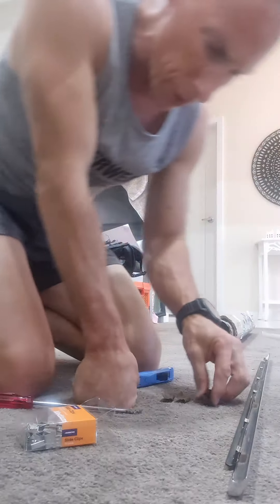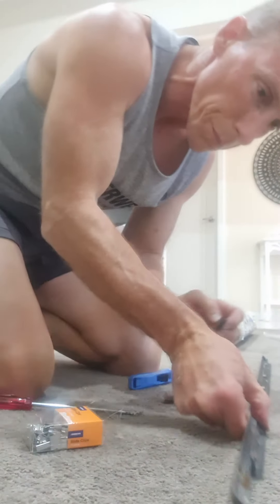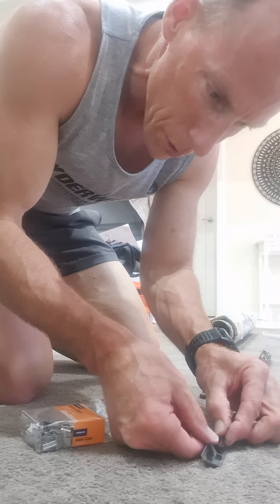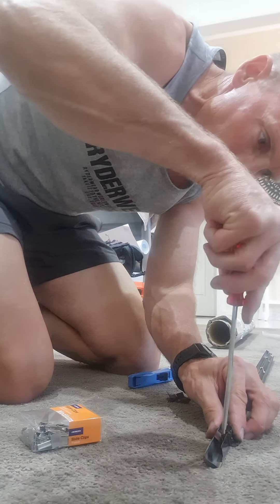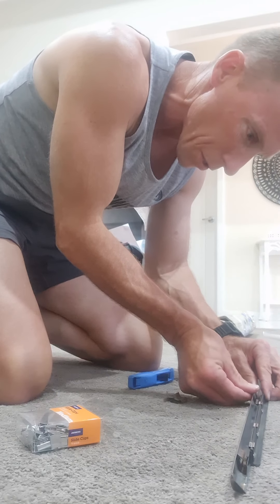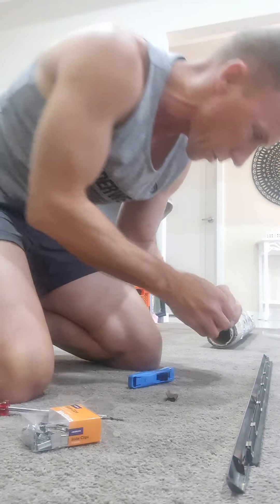These original clips are pretty hard to find — I haven't been able to find replacements, so I'm lucky my originals are in good condition. To get them back in, I just use a bit of pressure with a normal screwdriver. Make sure they're the right way down — the longer edge. On the wagon they're slightly bigger, so remember that if you're doing a sedan they're going to be slightly smaller. Push down and just lever back with your screwdriver. There are two little teeth, so put your screwdriver in between the two teeth, push, and slightly lever back — you shouldn't have any dramas.